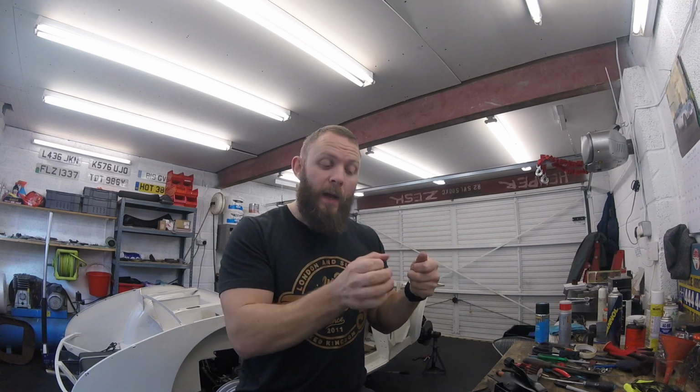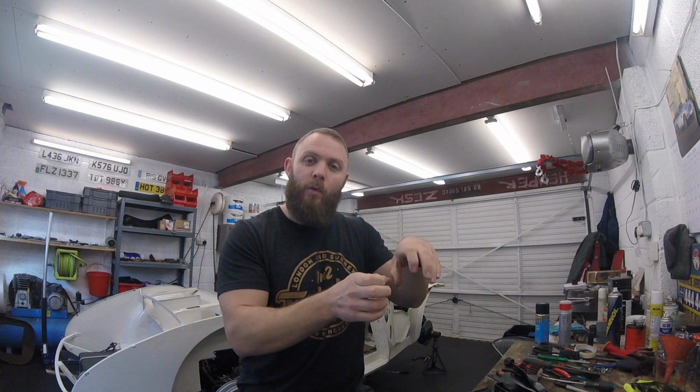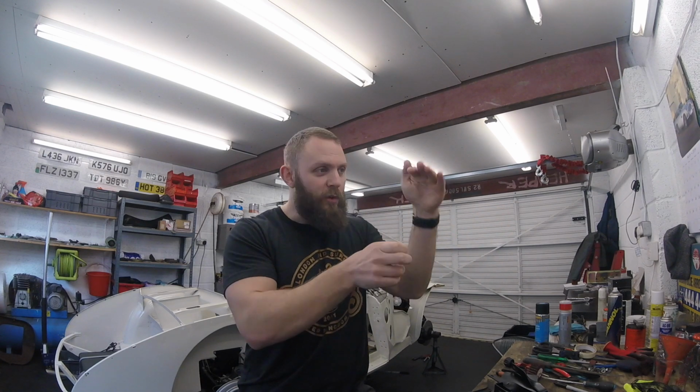Now, if you go back to last week's video, you'll see on the top of the gearbox, when the adapter plate is removed, there's a half round shaft just below the third motion shaft. That half round, which is protruding, should be the other way round and should locate in the bell housing itself to stop the shaft spinning round. What I think was happening is that half round was sat into the kind of oil gallery, if you will, in the adapter plate, which is why the adapter plate sat down okay. But again, that could have been contributing to our leak.